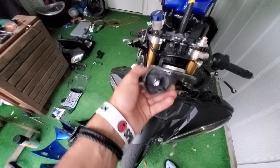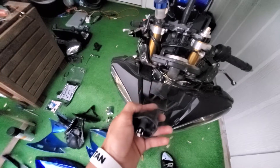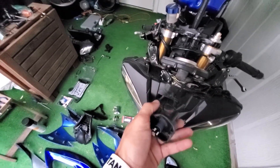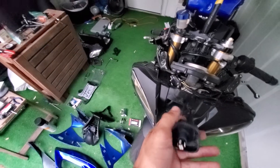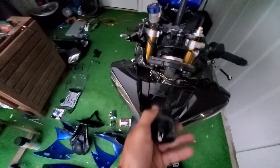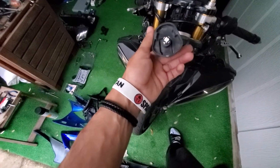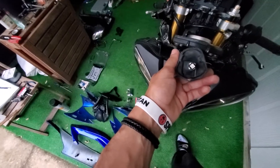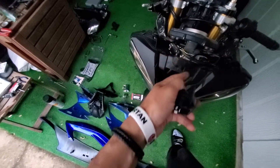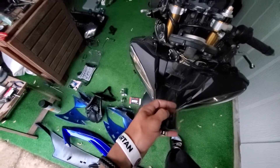That should help you out. Also, just double check — quickly plug the light right back in and turn the key in the ignition. Super easy, super fast way to check if the bulb works and if you have your polarity right. So now you know. Now that I've confirmed that the bulb does work and that my bulb is sitting right side up, I'm going to quickly disconnect this, get all the housings back together and just slap this right back on Storm — which is the name of my 07 R6.